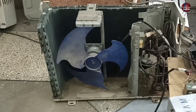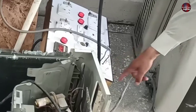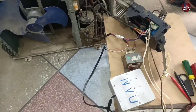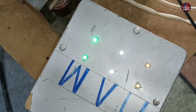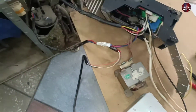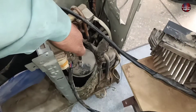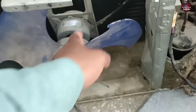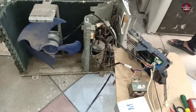The compressor of this inverter mini-split AC works, but the fan does not start. Let me pass electricity through it to show you as well. The indoor has started to work, and the lights have started to glow on the analyzer. This means all the IGBTs of the compressor are working fine in the control board. The voltages of the compressor are also increasing, and the compressor has started to work — I have put my hand on it to test it. But the fan does not start, so let's repair it and find what the fault is.